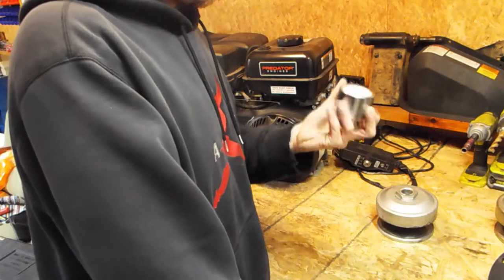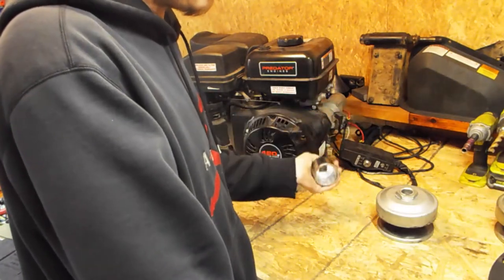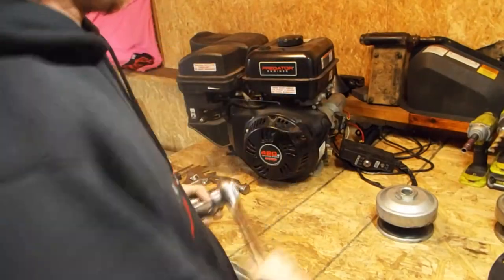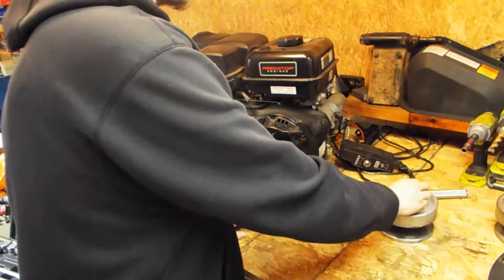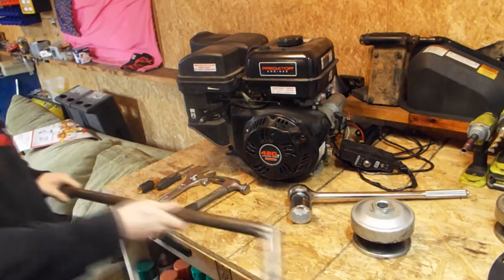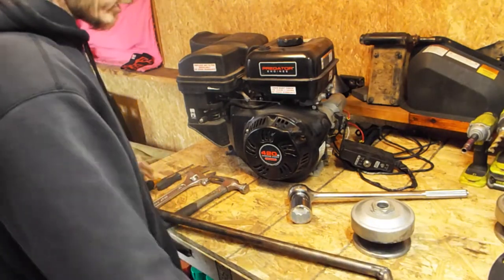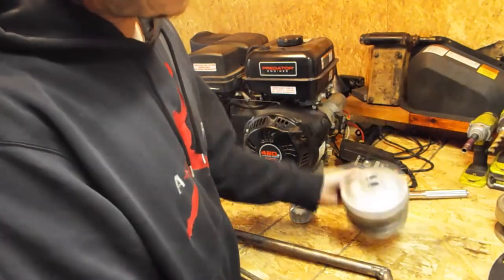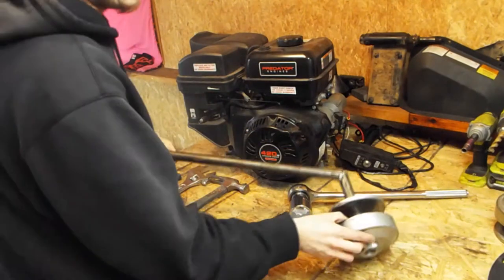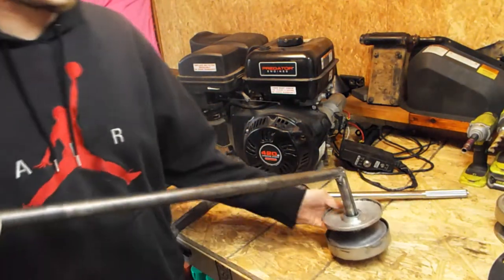If you don't want to spend money on the set, it's almost 60 dollars but with a coupon it comes down to about 48 dollars at Harbor Freight. Or, you can do what Cart Fab did — take an old one-inch axle, cut a little groove in it, weld it together, and create your own tool. Instead of clamping it on the vise one way, you clamp it so you can drop the tool in to hold the 45 millimeter nut and bust it loose.